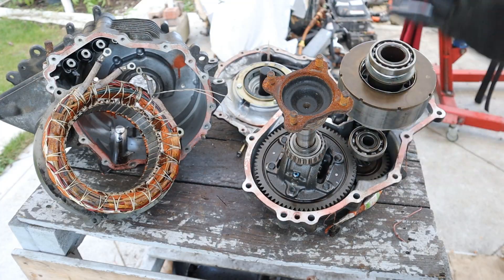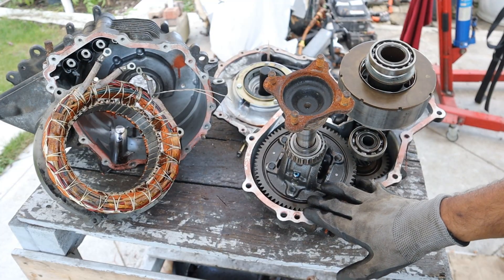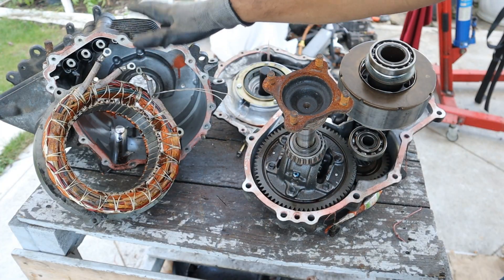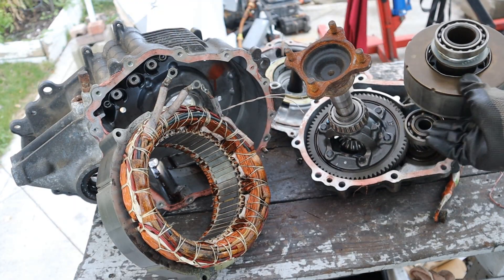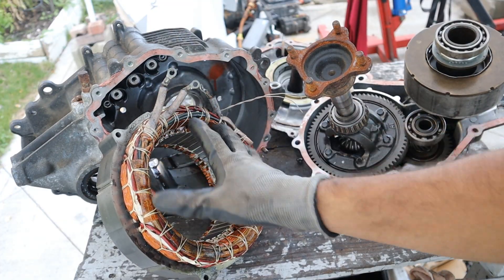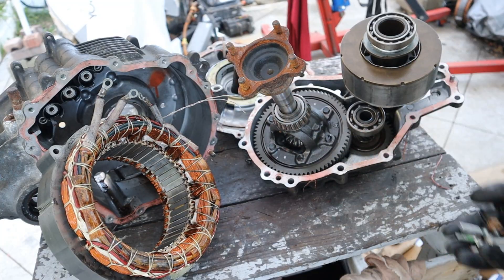Electric vehicles operate on the exact same principle you see here, except on a much larger scale. This one has passive cooling with fluid sloshing around inside to lubricate and keep the stator cool. It's got a little temperature sensor to monitor it, and you've got to make sure you don't undercoat the fins underneath the vehicle because it just relies on passive cooling. And I know a lot of you like to collect these to make little go-karts. All you need is a three-phase controller to control this motor and you can adapt it to any machine. Make sure you support me on Patreon and subscribe if you want to see more videos like this one.